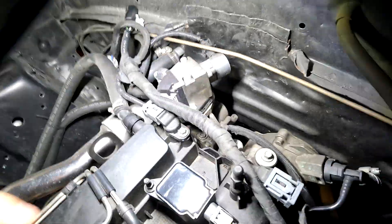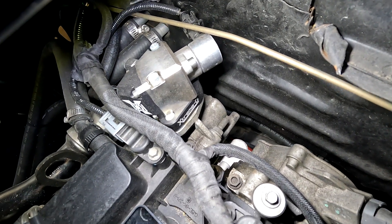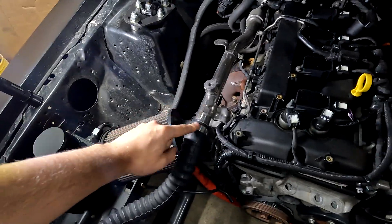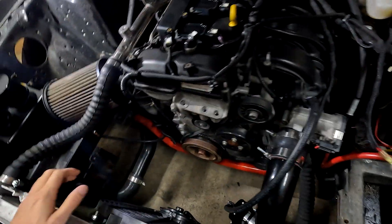Right below the water pump, there's a hose barb on the side there that the line goes to. Then all the coolant returns back up here at the end of this line for your hot return back to the rad. It gets flowing through the rad and then back to the system again.